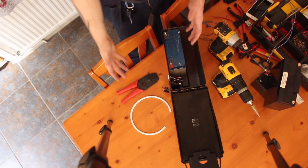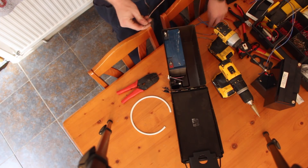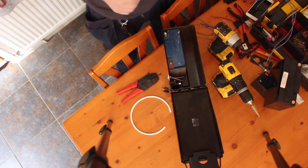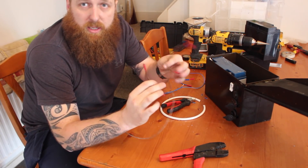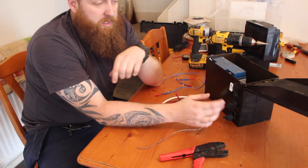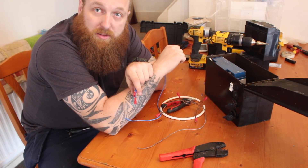Now we've got everything roughed in place, I like to start from the very bottom and work my way back towards the battery. We're going to start with the cigarette lighter charger output, then take the live and neutral from that into the USB one, then work our way all the way back. Everything's daisy chained along - the hardest bit is remember to put all the crimps on in the order that you want to do them, so it's just plug and play. The neutrals are a little bit different because we've got to incorporate the negative off the little LED light.